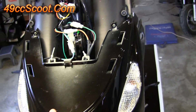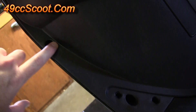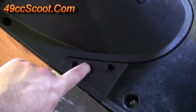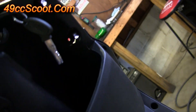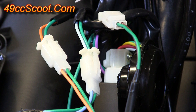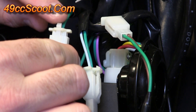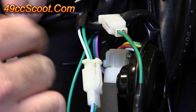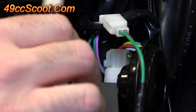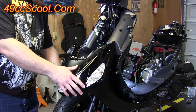Now I'm going to remove this front piece. You've got a screw here, here, and if you move around here you've got a series of screws here, here, and here — same thing on the other side. You've also got three connectors in here that you want to disconnect. If you're not 100% sure which ones, just trace these wires and see that they go to the side lights and front lights. There's a little tab — push in on the tab and pull each connector apart. Once all the screws are out, move this panel down — it won't actually clear the wheel and tire, but you can get it down out of the way.